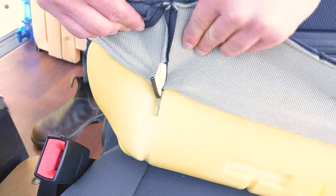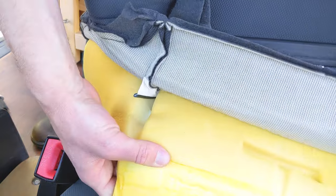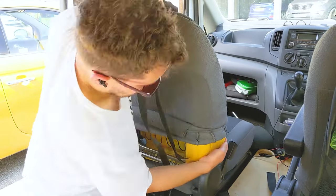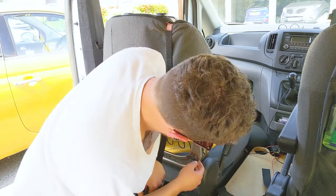Back to the seat — the fabric cover is physically attached to the chair foam, which means it will only pull up about six inches or so. You can pull the foam out from under the seat a little bit, but it only provides limited access. The more access you have the better, so I used a ratchet strap to hold the foam and fabric out the way.